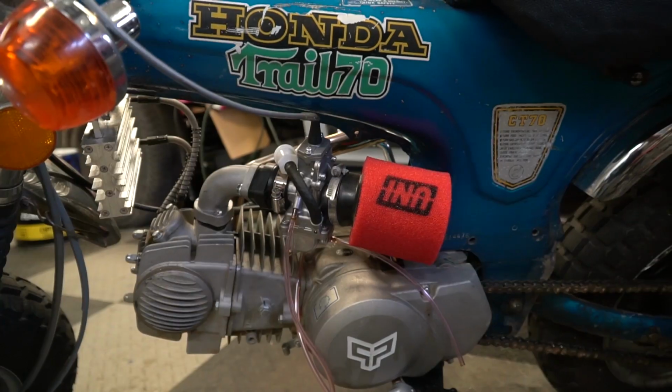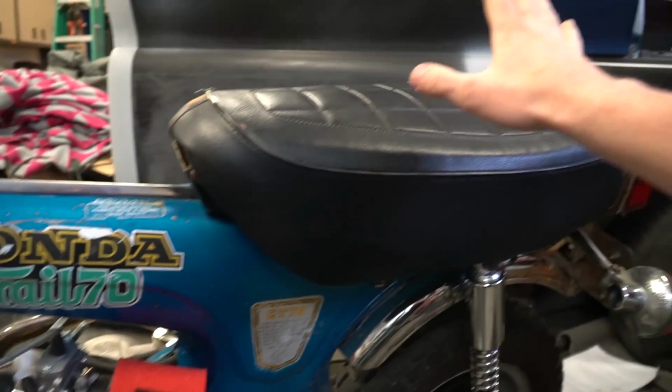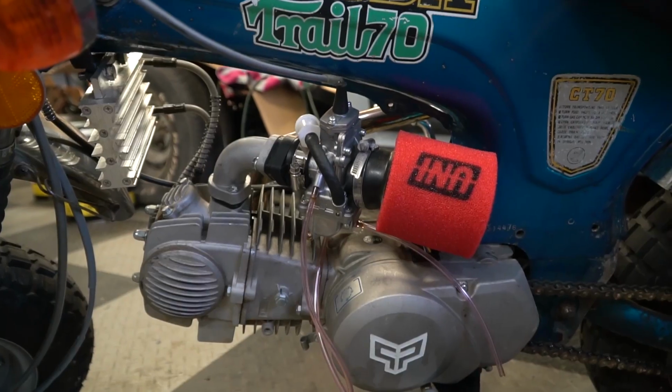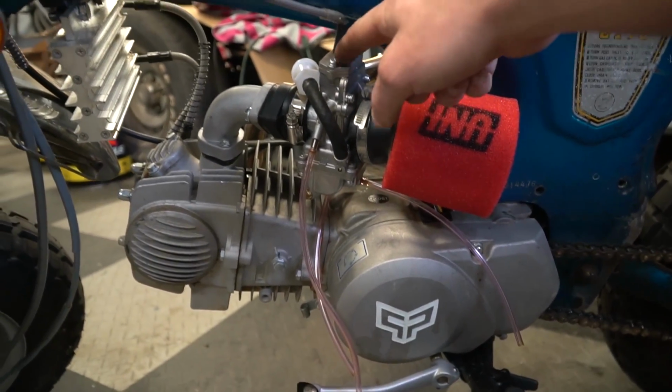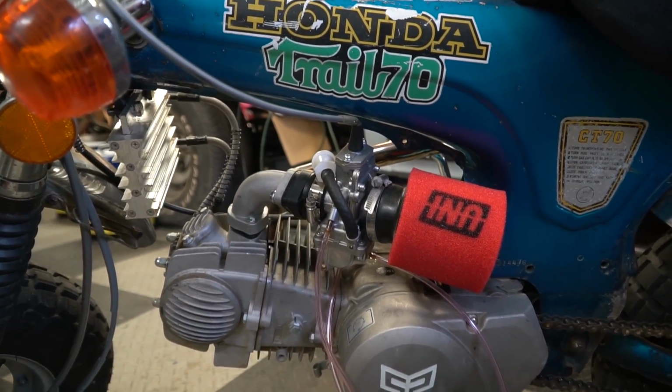And one more thing, all my problems with this bike are pretty much fixed. The other day, Ike and I threw a new CDI at it. I think that's what was wrong with it. The CDI? Yeah. But there were two problems, because after we got the CDI fixed, the other problem came up, that spark plug. We replaced the spark plug, which was bad. We replaced the coil. And Go Power Sports sent me a 24mm Mikuni flat slide carburetor, and that thing goes.